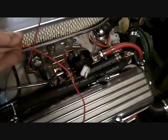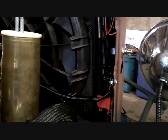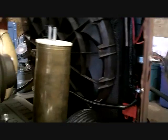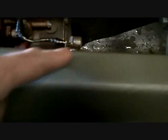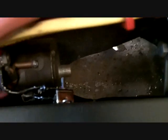Tickling the coil wire would just make it fire randomly. That's what it was, the electric choke. Last night I was studying the electric choke online, and it says you cannot connect this to the coil. It'll take the power away from the coil, so we've got to connect it to a switched power source, which would be, well, the fan, but the fan is hardwired and it controls when it's off and on. It'd be cool to put it on the opposite side of the fan, but the thing would never go off. So we can't do that. So it might have to go up the throttle cable and then up to the fuse block and to a switched power source. The breaker, well, for right now it's just floating here. I'm going to make a little angle iron bracket and probably just a quarter-20 bolt off the edge to hold it. But I didn't have the measurements for it.